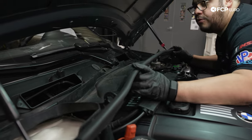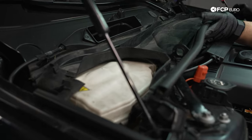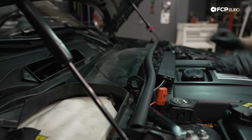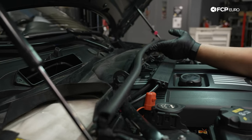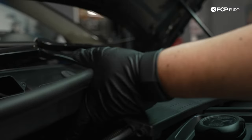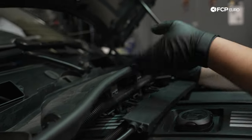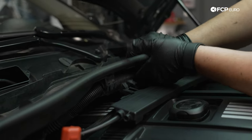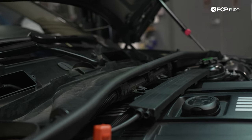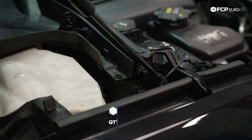Now just remember you're fighting that little rubber T. If you feel any resistance, it's from that. And just push it forward once you have it pretty lined up. And while we still have some play in it, we're gonna pull our power cable through and get that fed in into this area with the 3 clips, 2 tabs on each one. All right, now we can install the 8 millimeter bolts, one on either end. And we'll do the same on the other side.